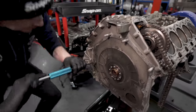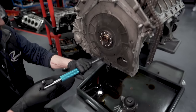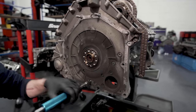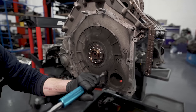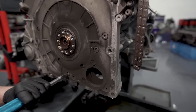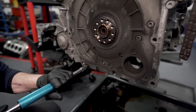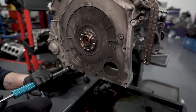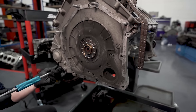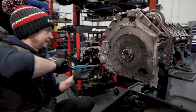You can see the rear main, look. Starting to have a hard time already. So this has got a racing transmission in it, so it's got a proper flywheel and a proper clutch. It's got a stacked clutch, but you can see where the rear main is starting to complain and weeping. And then the clutch dust is picking up on it. So that's why the rear main looks dirty, a bit tired, because the rest of it has been fairly mint, hasn't it?